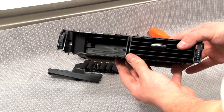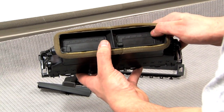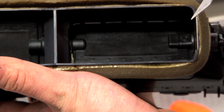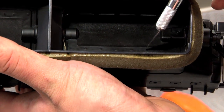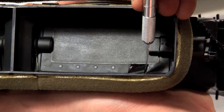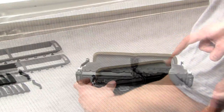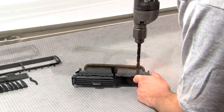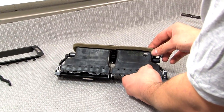This will allow you to cut a tab into your vent door. When you're looking at your assembly from the front, turn it around, and to make things easier, slide this door the opposite way of the other one — this will make cutting an access port into the door much easier. Using a small knife or razor blade, make an incision between the second and third dot on the flap door. Once the piece is cut out, remove it. Then turn your assembly upside down, and in the right upper corner, drill a hole using a half inch drill bit. The purpose of these holes is to allow you to route the wires to your boost gauge while still maintaining the functionality of the vent.